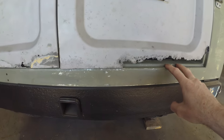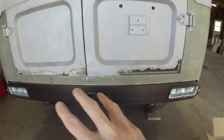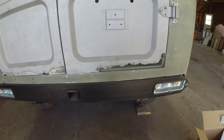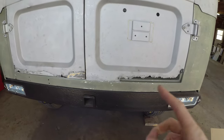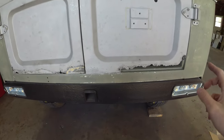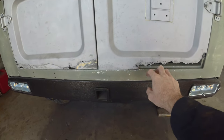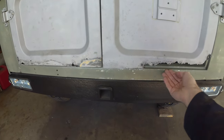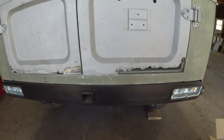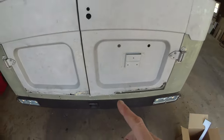This is an aftermarket tub, Columbia South America HFS tub. So there may be quirks. This is kind of a bit of a Franken cruiser, because it's got that aftermarket South American tub and some South American doors that you're not guaranteed to get exact fitment on any of that stuff. So we're going to have to probably cut this off and kind of slowly slot that in and get what looks like a good door gap on the bottom, and that's going to be our reference point. It's better to have doors that look right on the vehicle they're going to go on than be kind of to spec and square and then don't fit. You kind of got to work with what you got, do the best you can.